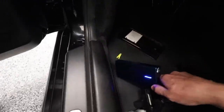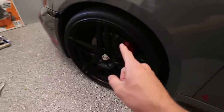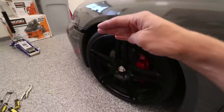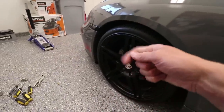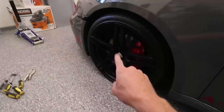So I'll show you how to manually access the front trunk. To get it to pop open, we need to remove the front driver wheel. We jack it up, get the wheel off, pull the wheel liner back a little bit, and there's a cable back in there that you yank and it should pop the hood. We've got to do that now, unfortunately — adds a little time to the project.